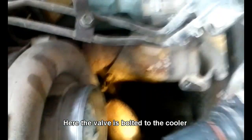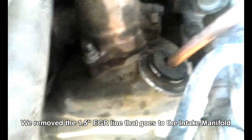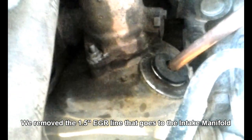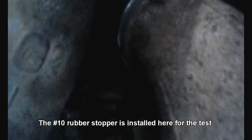Here we have the test setup for an EGR. You can see that down in there for the 2007 Freightliner Coronado — it's the EGR cooler. What we're getting is bubbles in the reservoir that are puking all the fluid out of there. If you look back in here, you can see that. I've used this bar here wedged up against this and down in the back of the EGR cooler, because you really can't see it.